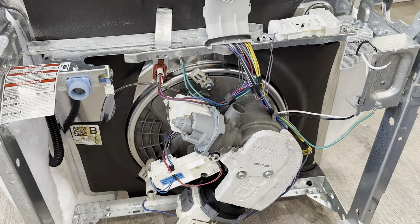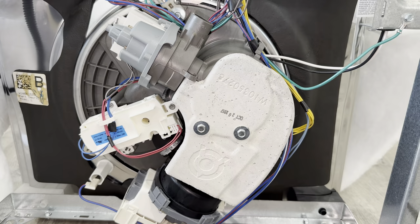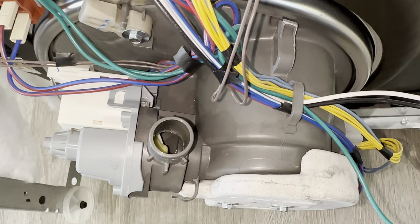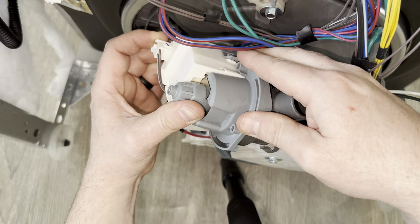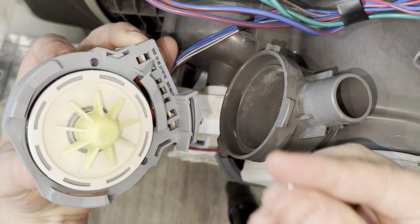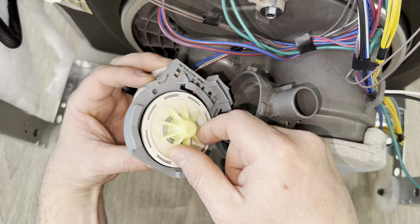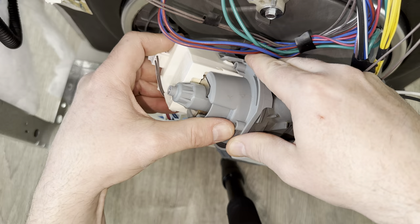Now I can get a better view of how this works. The clean water comes through here and is flushed out through this drain pump. This gray thing is the tiny motor that pumps the water out through the drain. I'm guessing this drain is going to be plugged up but as I looked into it it was totally clean and I'm starting to run out of options. With no other choice I'm going to look inside the pump — and my friends I'm happy to tell you that we found the root cause of all of our problems. It looks like a piece of a plastic fork broke off, or it's a vampire tooth. This probably broke off during a wash cycle which prevented these pump blades from spinning and flushing out the drain hose to the garbage disposal, which then would have caused the dishwasher not to drain. Or a vampire has been chewing on my motor again — both are equally valid explanations and we'll probably never know.